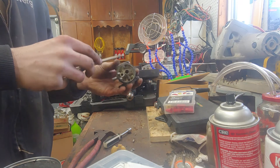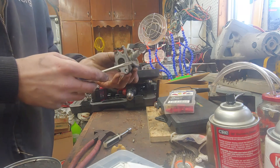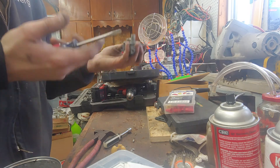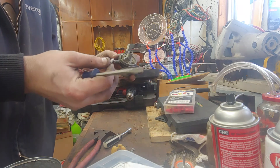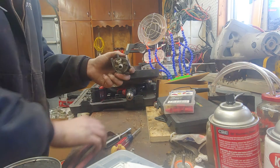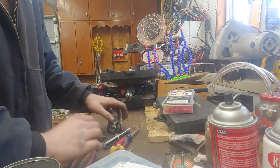That ethanol sitting inside the aluminum case just eats the aluminum and causes all this corrosion. The carburetor's junk. A new one from Briggs is fairly expensive; an el-cheapo Chinese one is probably cheap, but you get what you pay for. Some people also don't like the idea of non-OEM carburetors.